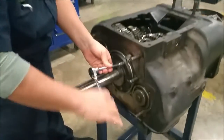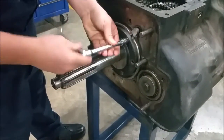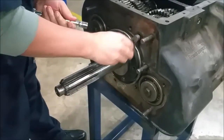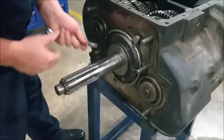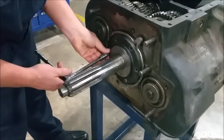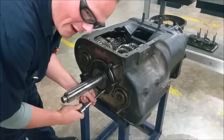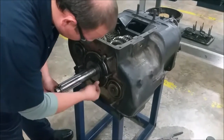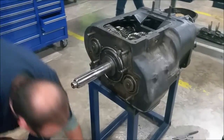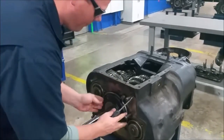So what we're going to do is take out the cover plate here. This is on a trainer that's going to be similar to on your vehicle. You can quickly take off some of the bolts. Get your flat head screwdriver underneath this cover and pop them out.